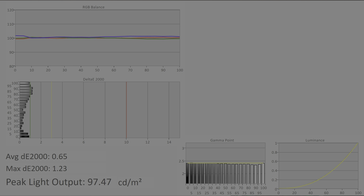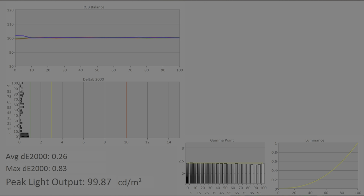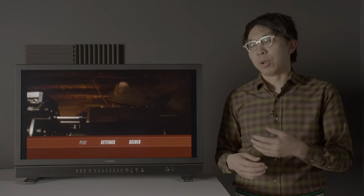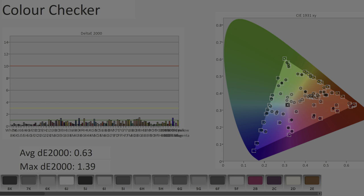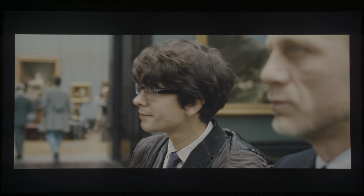Colour accuracy was excellent out of the box, with an average grayscale error of less than 1 in the BT.709 picture preset for SDR content. After calibrating our review unit using the onboard 2-point white balance controls, average delta errors dropped even further, though there remained some minor blue tint near black. To correct this, there's the option of uploading a 3D LUT to the monitor — for example by using the Calman calibration software — but we didn't have time to pursue this. We were reasonably happy with an average delta error of 0.63 on the challenging colour checker SG chart, and when we scanned through some of our reference scenes, they looked spot on.